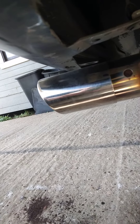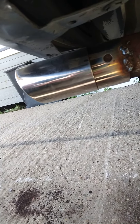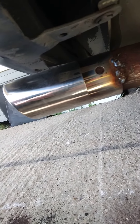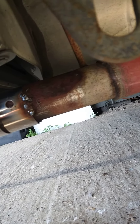Let's talk about exhaust tips. Normally these little exhaust tips you get from an auto parts store come with cheap hardware. As you can see on this vehicle, I've got a glass pack coming back — a cherry bomb — and I just wanted something a little nicer. I got this stainless steel exhaust tip, and it came with some cheap hardware: basically just flat-end bolts that go through and push against whatever you have existing.